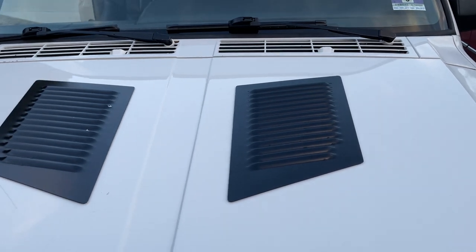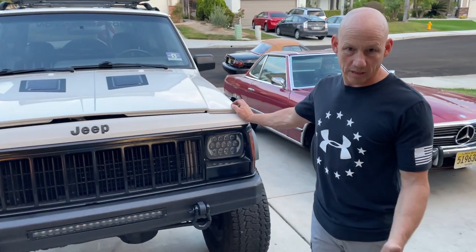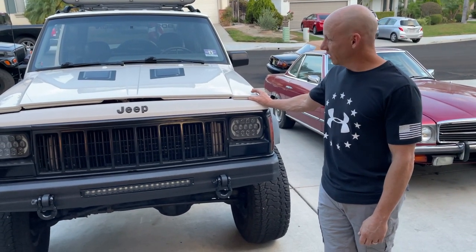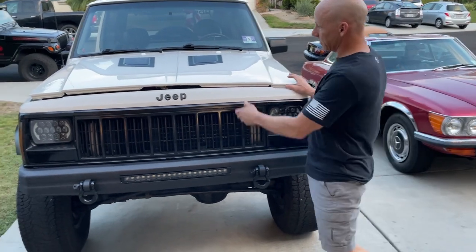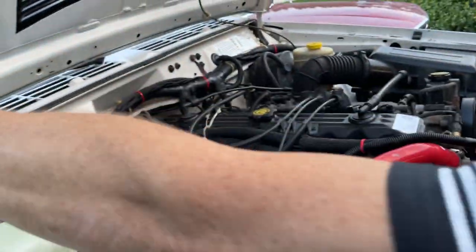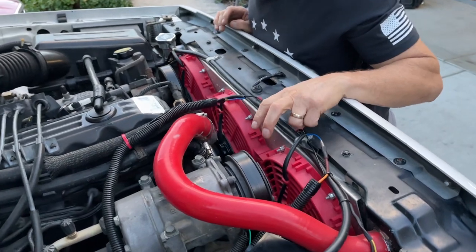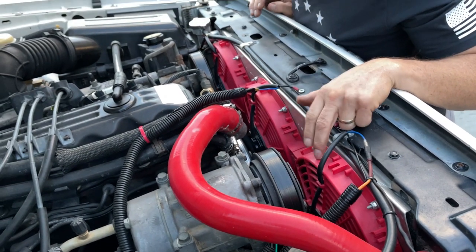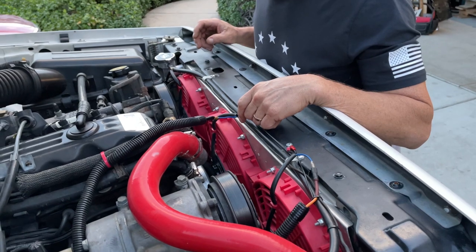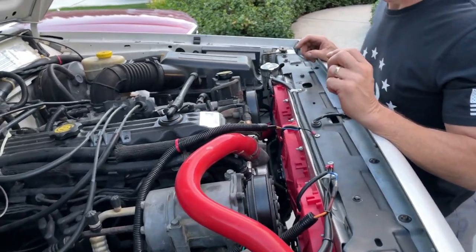On the hood, all Jeep 4.0s seem to have an overheating issue, especially here in Southern California where aftermarket mods add weight. Out in the desert heat, climbing really takes a toll on engine temp, so it's a way for heat to escape — it's not just a cosmetic mod, it's cut right through. For the cooling system, we removed the clutch fan and upgraded to three much higher-volume electric radiator fans. We also went with a three-row aluminum radiator, which has marginally helped.